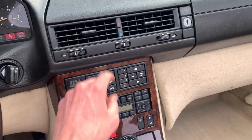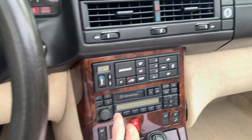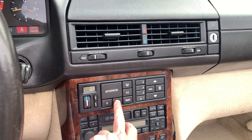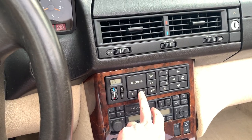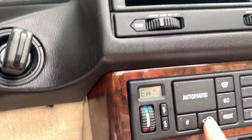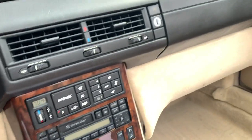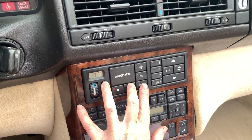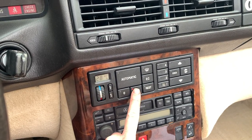When I originally read this, the car was up to 100 degrees Celsius and the temperature sensor wasn't reading — so the coolant was hot and it should have been wanting to run the fans. Some of the sensor readings are a bit nonsensical. The coolant temp is reading around 50 degrees. The only way to exit the diagnostic mode is to turn the car off, and then we're back at 70 degrees Celsius. When I turn the car on and read the codes again, there are no stored codes for the coolant system.